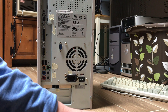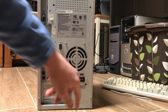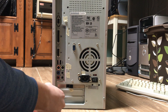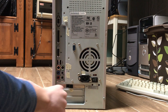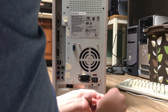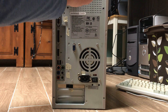This is going to be a full teardown all the way down to the board. So step one: grab your T15 Torx and unscrew the case screw there, case screw there, and another case screw up there. Also ignore the bandaid on my hand — I cut my hand when putting this back together last time I took it apart. That seems to always happen to me when taking apart desktops.